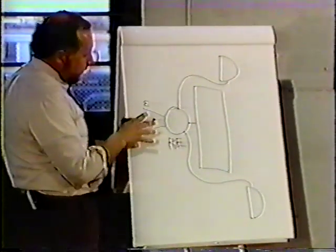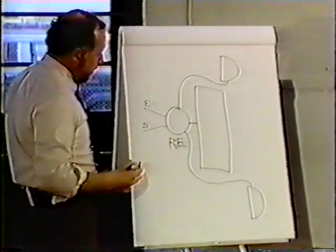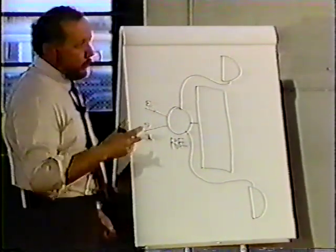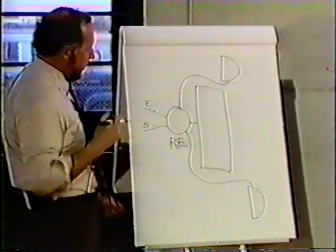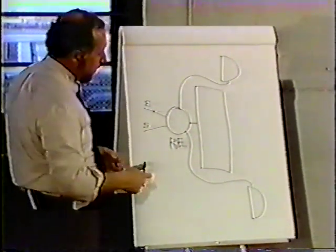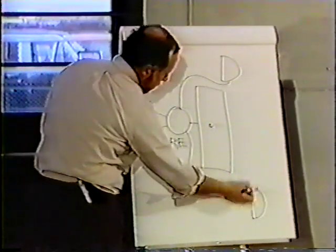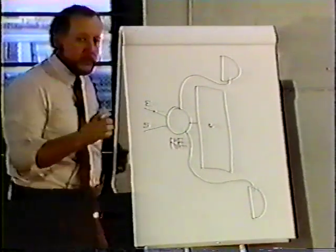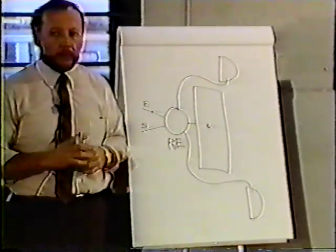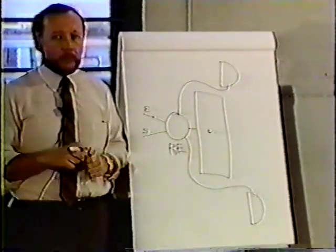What was different about this system as opposed to our new system is in the emergency portion. When this pressure dropped, whether you disconnected the hose or pulled the red or yellow button out, the emergency portion would notice a drop of pressure, would take this remaining pressure and deliver it to the service chambers. In essence, you were parked on air. Now, overnight, the air would bleed off. There were no spring brakes, and you were parked on your landing gear, or you were parked just on your tractor brake.